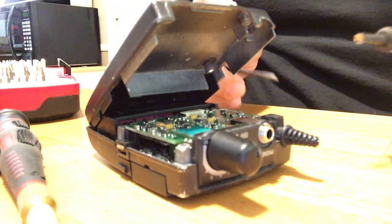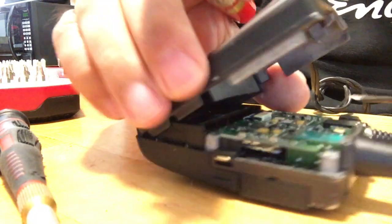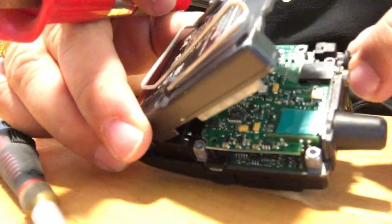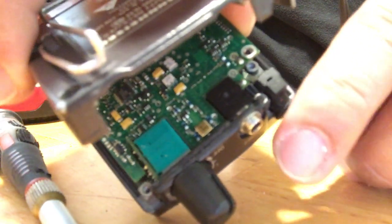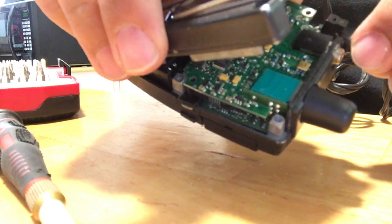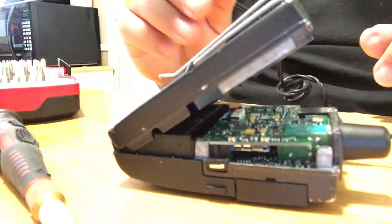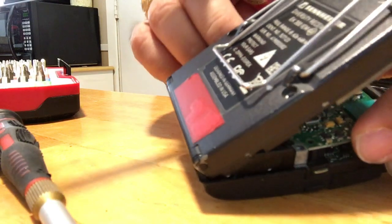What we're going to do is push down on the flat surface while heating it up, so it'll pop out of the circuit board. I'm only one person trying to get this done. So let me pop it down, heat it up — want to make sure it goes all the way down. It cleared — it did exactly what I wanted it to. I pushed it down and now I can just pull it out. Put the replacement in there; you could put a little flux on it if you wanted to, but I think there's enough on the circuit board. Make sure it's sitting where it's supposed to be, and then put that circuit board back on it, line it up, and heat it — it should fall right back up on top.